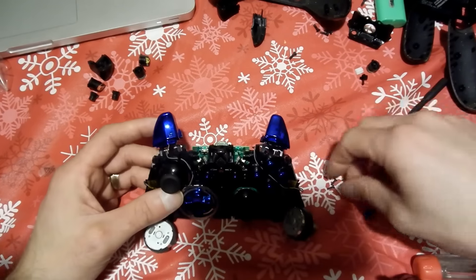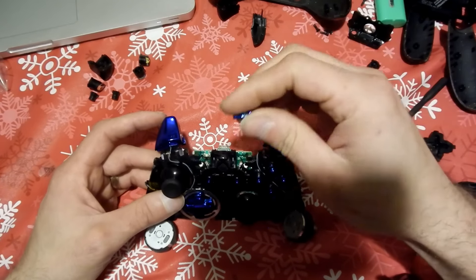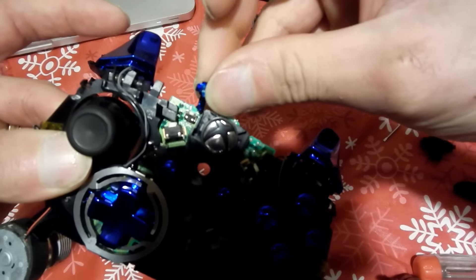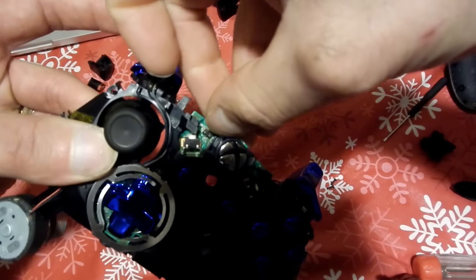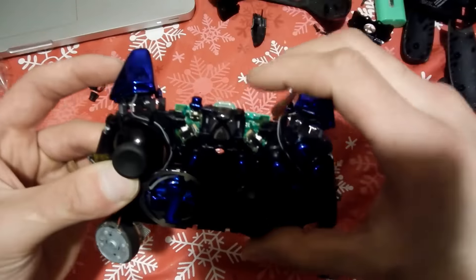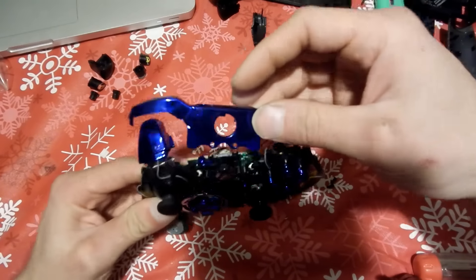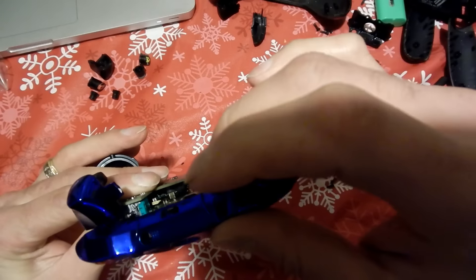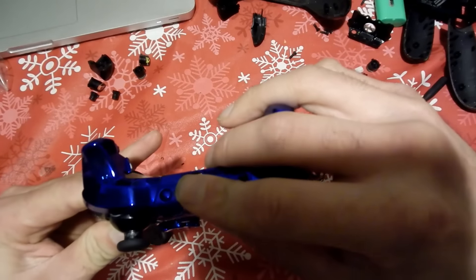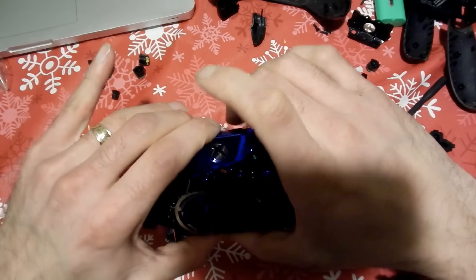You see that little sync button up there on the left, right above the guide button? This little plastic piece goes in one way — it just slides into the groove right next to the guide button. You'll see a little groove there, it just slides right into place. That's the first thing you want to put on before you put the top assembly of your controller back together. Now go ahead and put the top assembly right into place — fit it right over the micro USB plug on the top and snap it right into place right over the guide button.